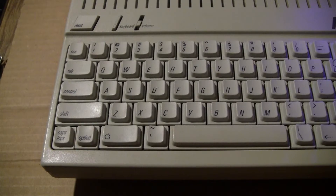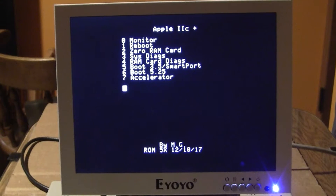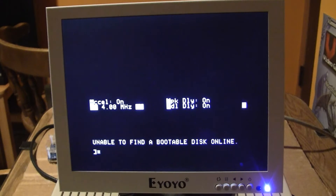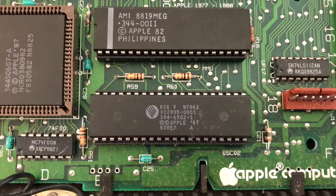What's so special about the new ROM chip? When you do a Control-Option-Reset, a menu appears with a lot of helpful options. Number seven was one of the main reasons I got it — to make it easier to bump down the acceleration on the computer and have it persist through resets. There's also an easier way to get just to the accelerator: if you do a Control-Tab-Reset, it brings you right to the accelerator, and you can hit A to toggle between on and off and keep it off.